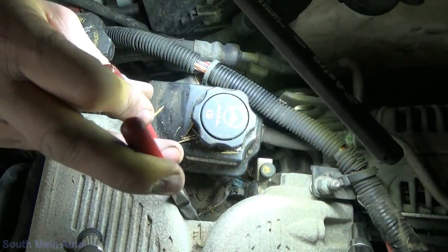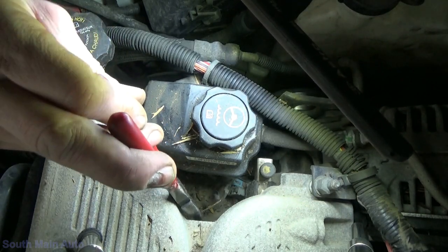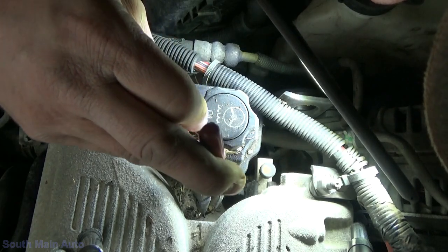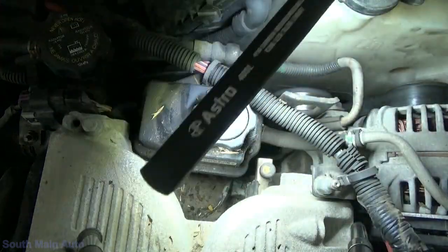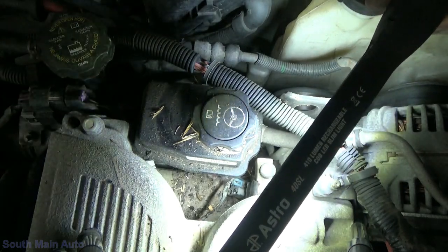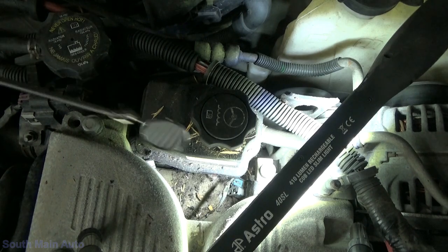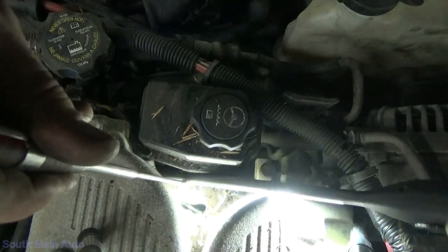So that bare wire there — it must be the control wire, because you can hear it shorting out. We're firing the injector because the key's on. Good thing it's a control wire. So that's the control side of the injector — we'll leave that alone for right now. Give me a small mirror here — I'll see if I can just look under that intake. The wiring's got to run under there, and if there's more rodent nests under there, perhaps they did a little chewing.